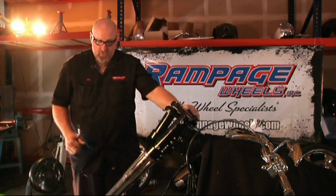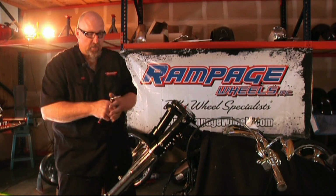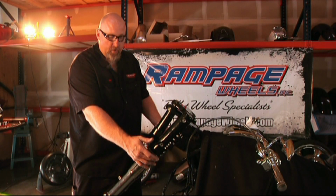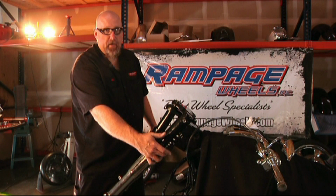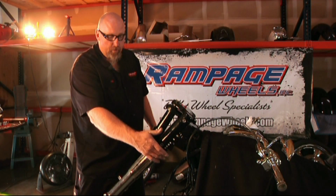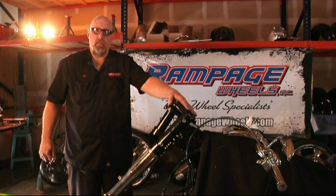After you have the front forks up inside, it's time now to torque up all your parts. You're going to do 18 foot-pounds on the quarter 20s, and 24 foot-pounds equally on your 5/16 18 on the lower triple tree. Past that, it'll be time to start reassembling the bike as you took it apart.